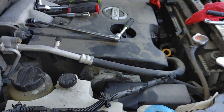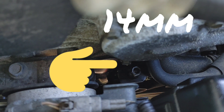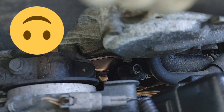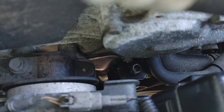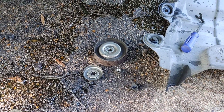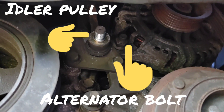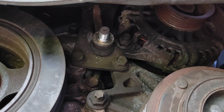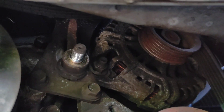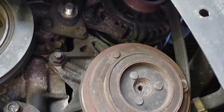Right beside your big plastic valve cover is your belt tensioner. You have to get the belt off your alternator. Put a 14-millimeter socket in there on a wobble extension — a universal joint works even better. If it hasn't been loosened in a while, the idler pulley area will be pretty seized up and may come apart. When reassembling, note there's a groove on that bolt that goes into the bracket, so make sure you put it on correctly or it will fall apart.